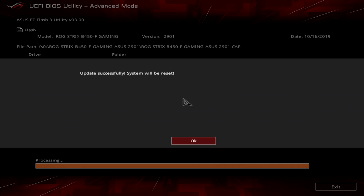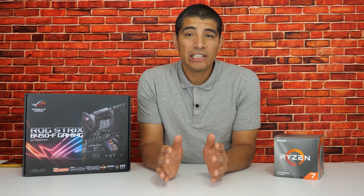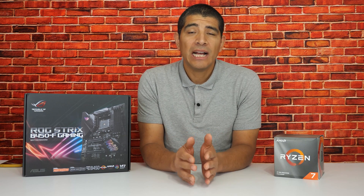It's important to keep in mind that the flash process can take a couple of minutes in its totality. In some situations, the flash may go through fairly quickly and finish in as little as fifteen to twenty seconds. In other situations, it may run a couple of minutes. In both cases, this is entirely normal. Under no circumstances do you ever want to shut down your system — allow it to complete all the way to one hundred percent, and then you'll be advised with a message letting you know the flash process completed successfully.